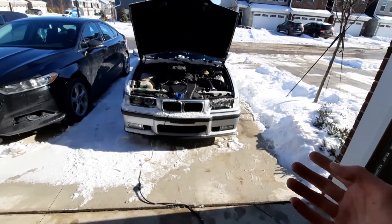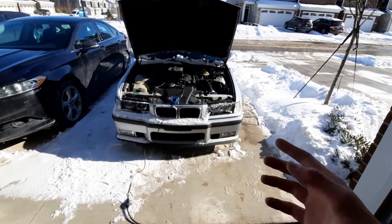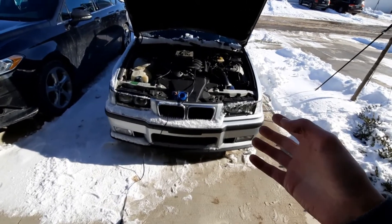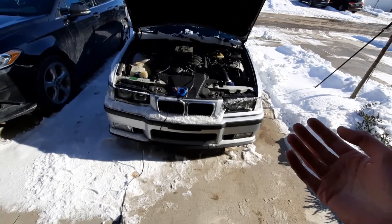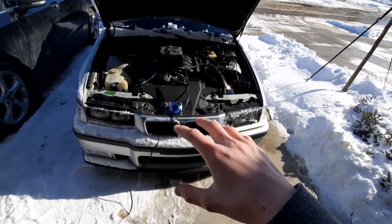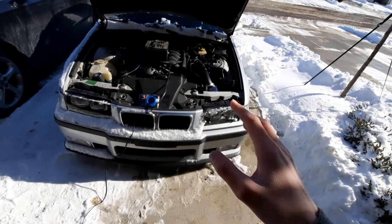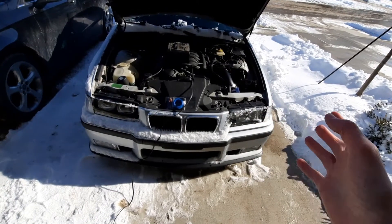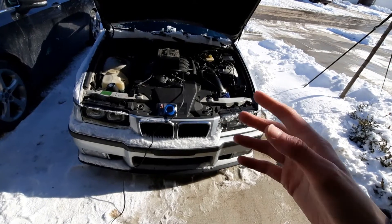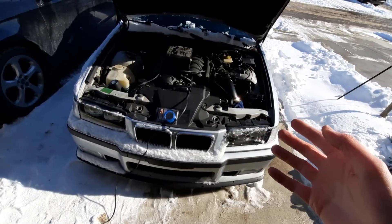Hello everyone, this is a tutorial on how to flash your OBD2 BMW E36 with an RK tune. This works for any tune, not just RK — mine is specifically RK, hence the title of the video. I'm going to show you how to put it in the right mode. This is just like a standalone tune where you want to flash your ECU. This doesn't work for OBD1, obviously. OBD2, MS41 ECU — so any M52 or S52 motor — is what this applies for.